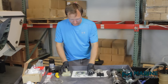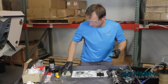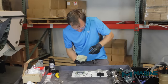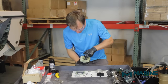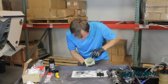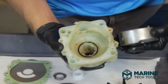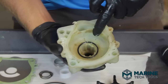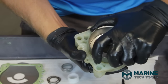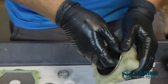Starting reassembly: use a little dab of grease wiped inside the water pump housing to hold everything in place, because our little o-ring likes to wander. Press it into its groove and leave some grease on the sides. Give it a final visual to make sure it's nicely set. Now take the cartridge insert — it has alignment tabs that match up with alignment grooves in the water pump housing. If the alignment is off, this will not seat correctly and you will have a problem, so it's very important to make sure alignment is good.